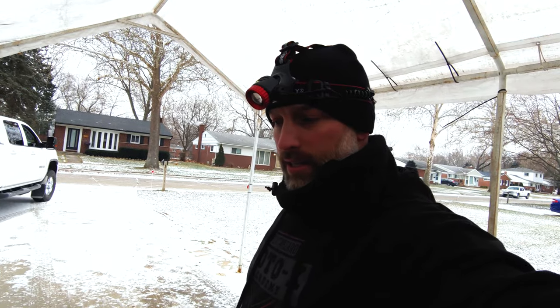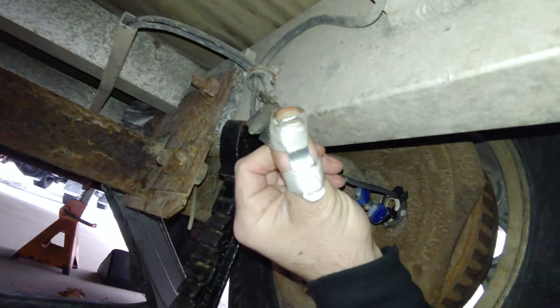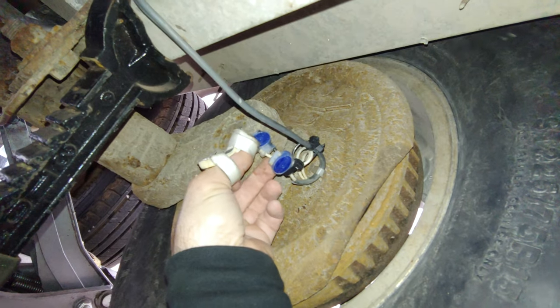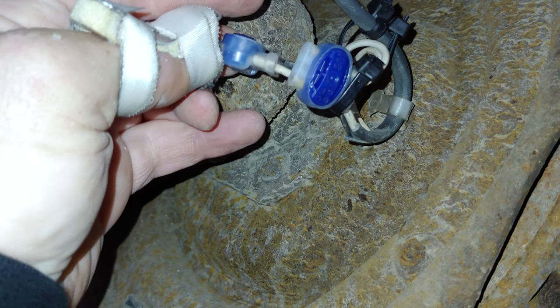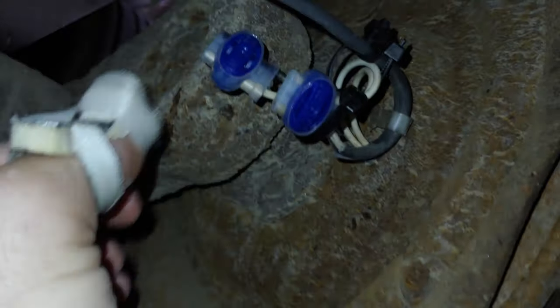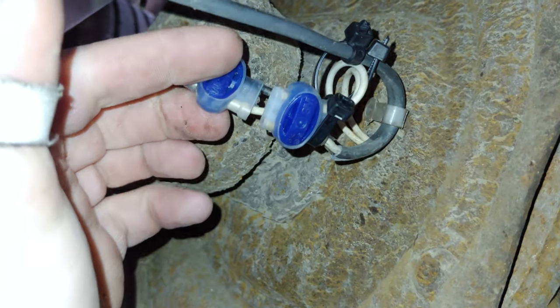Okay, so now we're underneath the trailer here on the same side. These were the butt connectors — I didn't actually know what these were at first. They're really just triple butt connectors. What they do is you slide the wires in the end — freshly cut wires. They have three holes on the bottom, and before you use them, these little posts are sticking out about a quarter of an inch. What you do is just slide the wires in and then pinch them down. You don't have to trim the wires or anything — just have a nice clean cut and crimp them down real hard and it pinches.